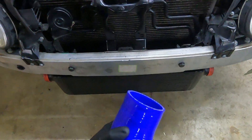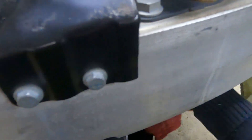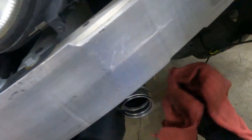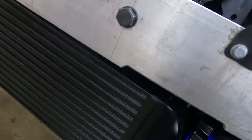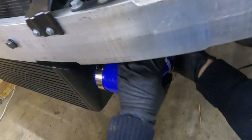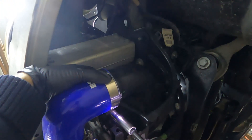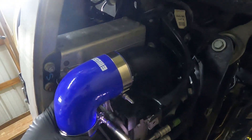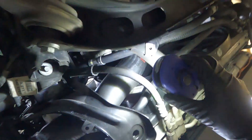When the hoses came in, I cleaned them up good. I had to carefully degrease the metal portion of the OEM hoses in order to make certain that when I clamped the new hoses on they weren't going to slip off. Then I was able to fit them, and I put the T-bolt clamps on in a way that the bolts would hang downwards on the inside - this makes it easier to reach from underneath the car. As you can see here, they don't interfere with anything. Once I had everything cinched up tight, I used a 10 millimeter deep socket to get those T-bolts nice and tight. Then I got a light and checked to make sure I wasn't pinching the OEM hose and that it wasn't going to rub on anything.